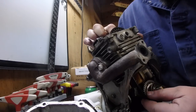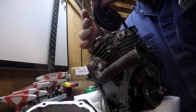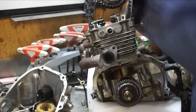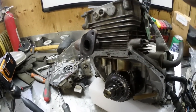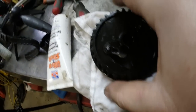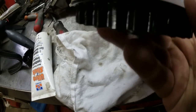I'm trying to get this gear off — going like that, and then yeah, we just pulled it straight out. The key is once you pull the pin out, push down, pull the belt off the bottom, and pull everything out from the top. Now we've got the timing gear here.